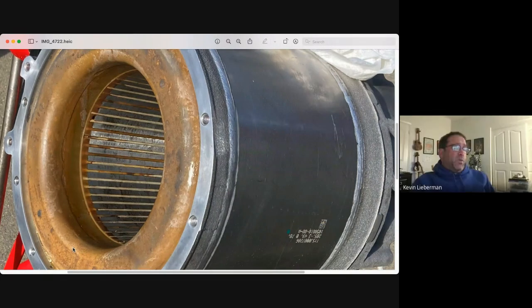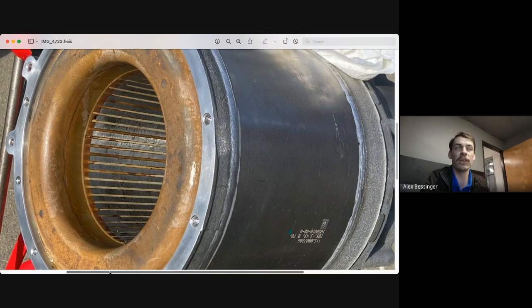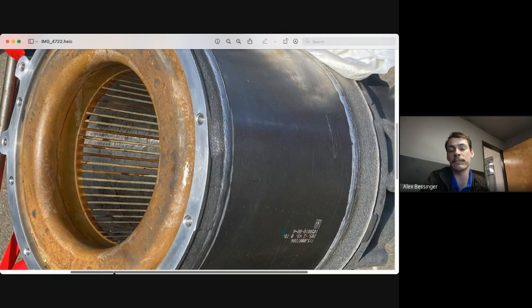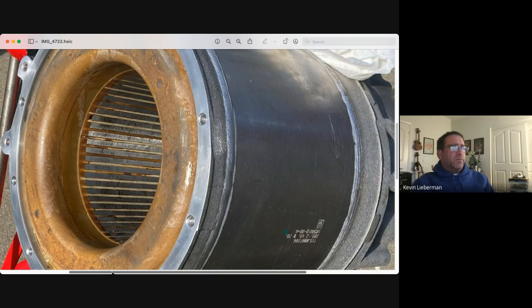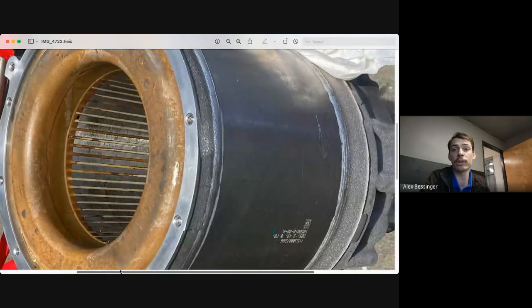Okay, so in that case, will you get a check engine light equivalent or something? Will the car tell you there's a problem? You'll get some kind of error message. There's a couple different error messages that will be associated with it, but on most of the Tesla powered stuff, you'd get what's called a BMS W023. And is that something visible to the customer without a scan tool, or is that only something you'd see with a scan tool? In a Model S, you could see it without a scan tool. You just have to go into service mode.